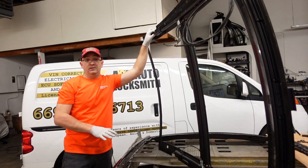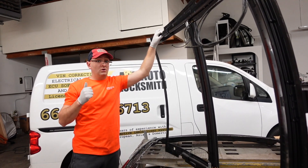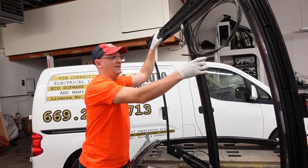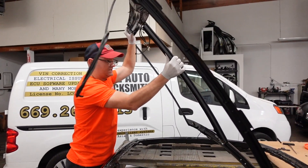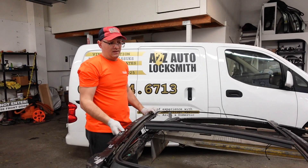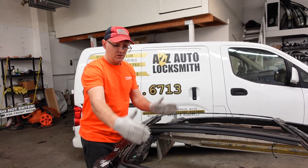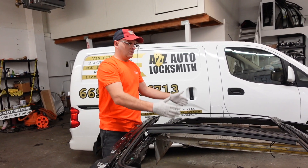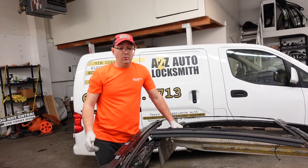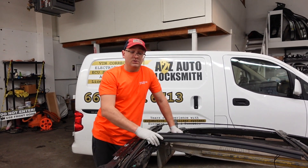After that, you can upgrade. If you have the old Model S, you can go with the 2.1 version — it works great. But remember, if you do upgrade the housing to the next version, you have to upgrade the panoramic glass as well. It doesn't fit from version 1 to 2.1 — you have to have it upgraded. Rear glass as well — you have to make sure it comes from 2.1. And then you can reinstall everything back together. That's how it works.